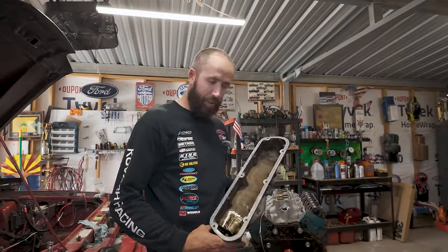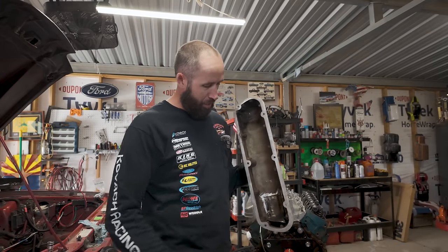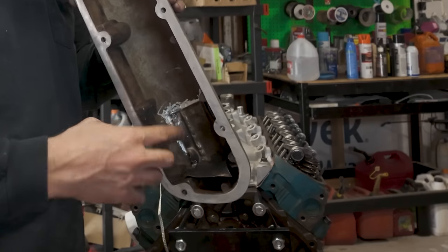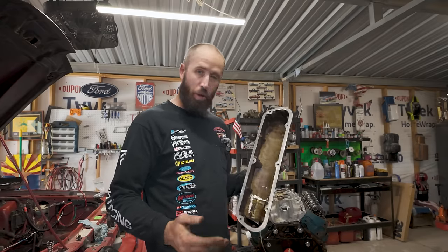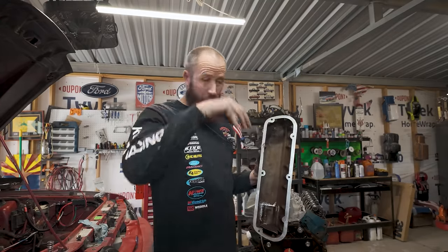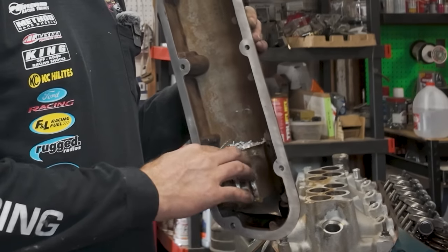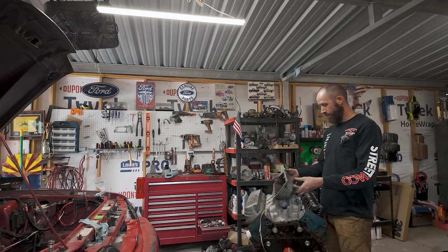Okay, so here's where we're at with this thing. I beat the piss out of this thing like it owed me money or as a stepchild, one of the two. Haven't figured it out yet. You have to shave a whole bunch of the inside off here and then flatten out the baffle over the top of it. Getting oil back in here is going to be a little slow, but at least it clears the rockers, and at least we're not going to be sucking up a whole bunch of oil into the intake with that port that goes into the throttle body. So this is what it looks like, and it clears. So now we can throw it together. I'm going to go get some nuts after that, and then we can finally paint this thing. Maybe. I'm hopeful.